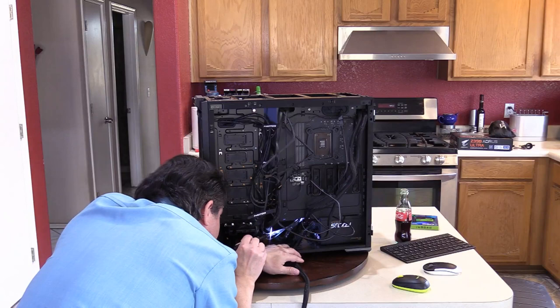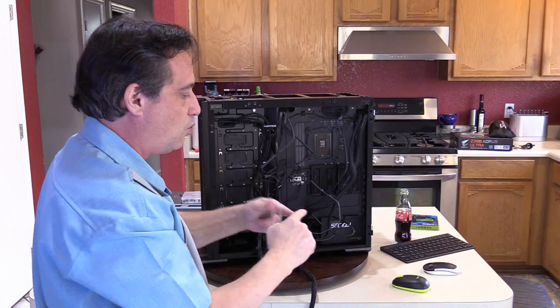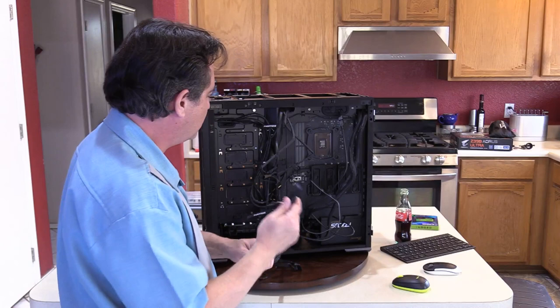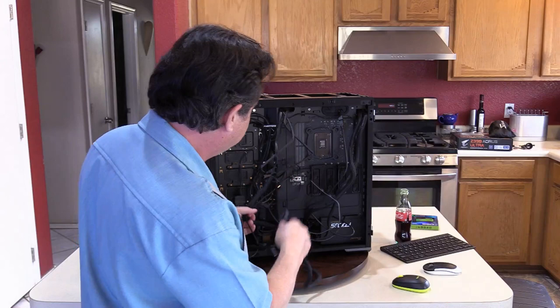There's three for PCI Express and three for SATA. So start one at each end, and then the middle's wide open that way. If you need to get in there next to the SATA connector, having this one all the way back would make that space even narrower and more difficult to get into. So that's the logic I'm using. That's my story, and I'm sticking to it.